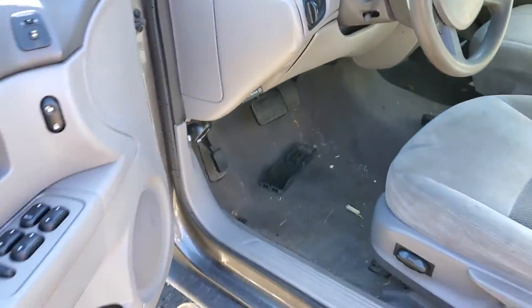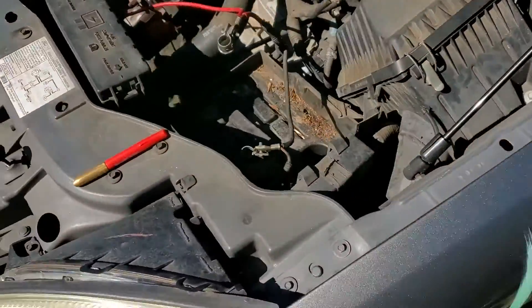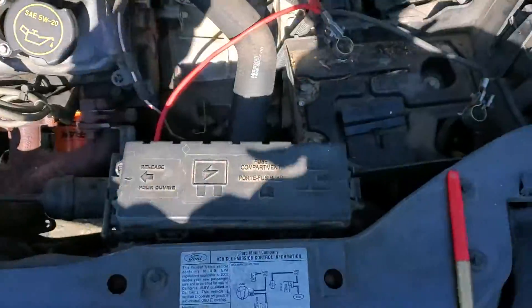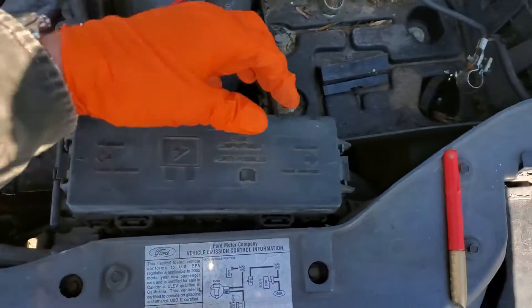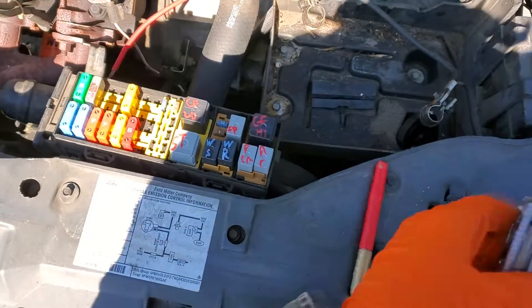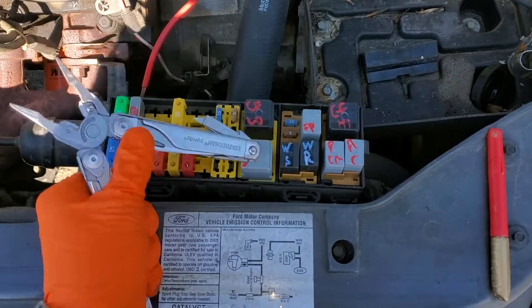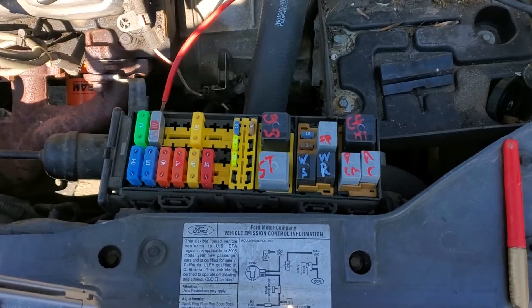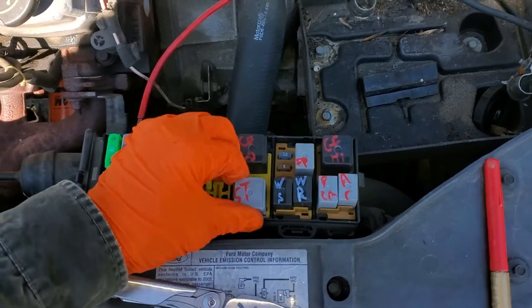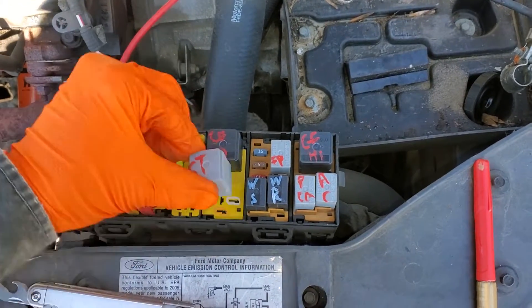Let's head under the hood and I'll show you the other fuse as well as the starter relay, and go over more details about how everything is wired. We're going to remove this cover by pulling up on these two tabs, one on either side. This is your starter relay — sometimes you can tap on the relay while someone is trying to start the car. Unfortunately there are no other similar relays you can swap this with, so let's pull this out.